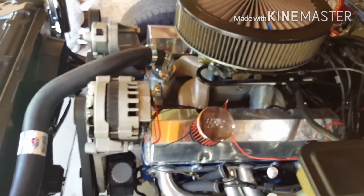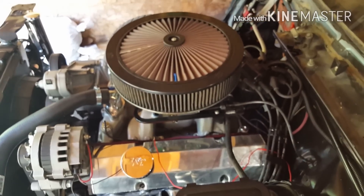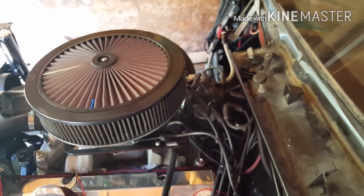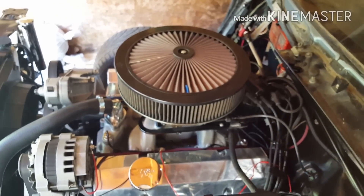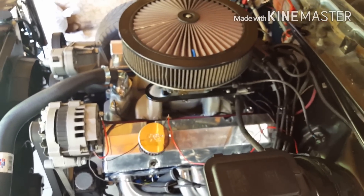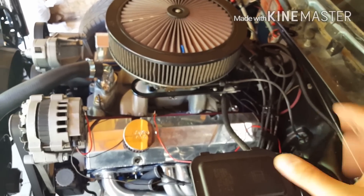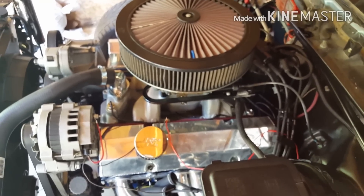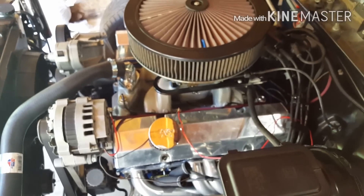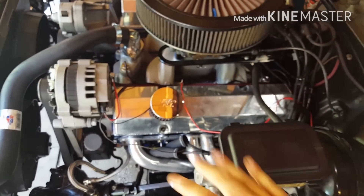Just figured I'd update y'all on that. Not a lot left - I've been messing with it the last few days. I think my timing might be off; my distributor might be off a tooth. The E85 stuff is crazy - we have the timing higher than you should on a small block. When timing an engine you turn it until you get detonation or pinging, then back it off to a safe spot. 12 degrees on a small block Chevy is standard; we have it about 13 and she kind of likes it, but I'm still having a little bit of issues. Now that I have my charging figured out I'm going to start messing with the tuning.